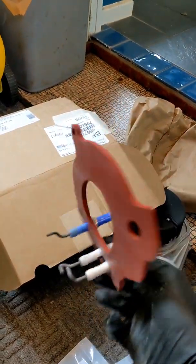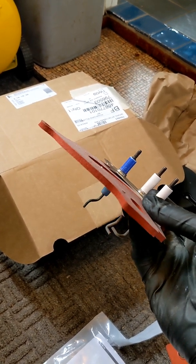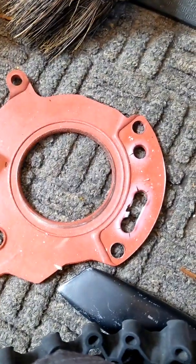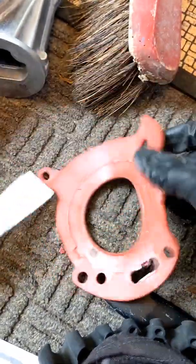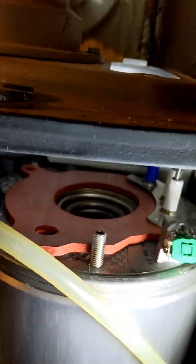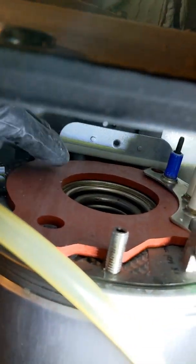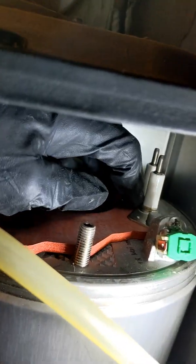It's always a good idea to bring a spare gas pipe tube and a spare set of electrodes just in case. The fan comes with a new gasket, as does the new set of electrodes and the gas pipe tube, because changing any one of these components requires removal of the fan — so they all come with a new red gasket. The old one is cracked, brittle, and very thin — on its way out. I'll set the electrodes up with a new gasket and pop them back in, just wiggling it in so they drop back into place.